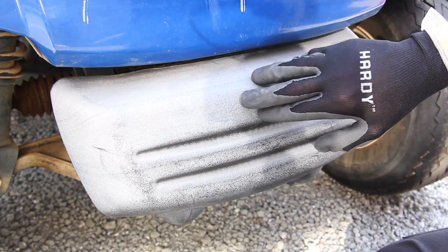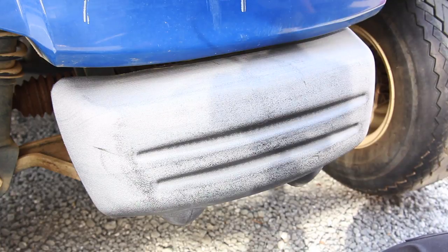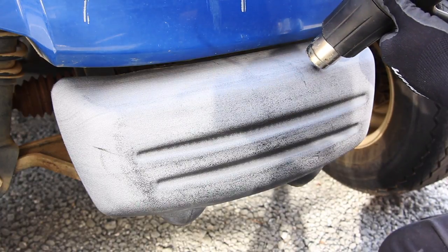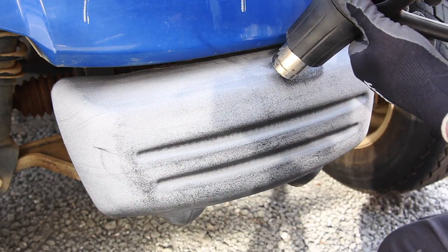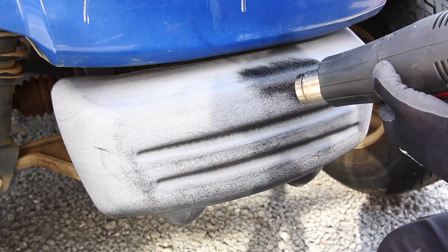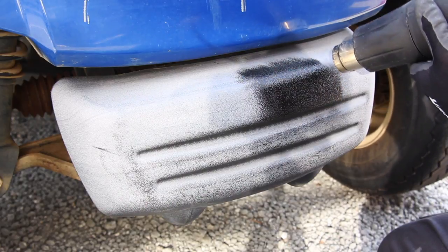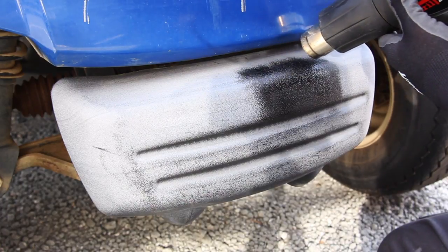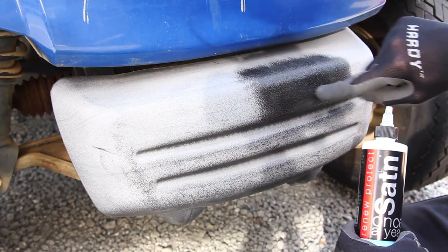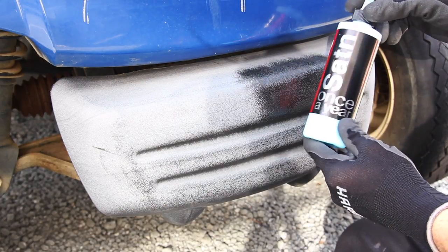In this case we are going to use the heat gun technique, which is a last resort and you have to be very careful with it. The key is to keep a consistent distance from the surface and consistent movement. Once you've got the right distance and the right level of heat, you can see it's pulling the elements up through the plastic and restoring the surface. You have to be very careful around your paint and clear coat. Now we've got that restored with the heat gun. We want to avoid using the heat gun again — it actually weakens the plastic — so we're going to seal it with the RenewProtect satin, the lower gloss.